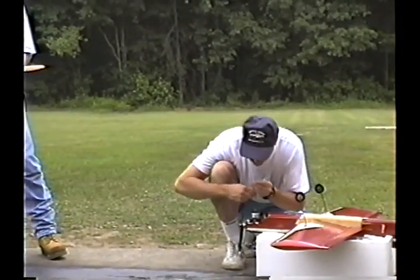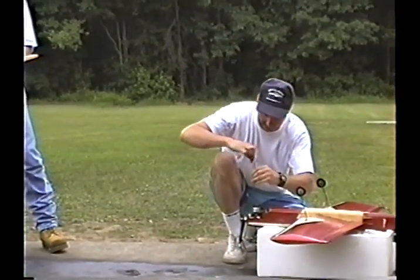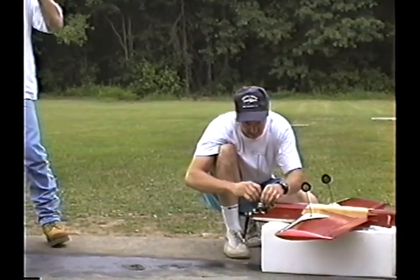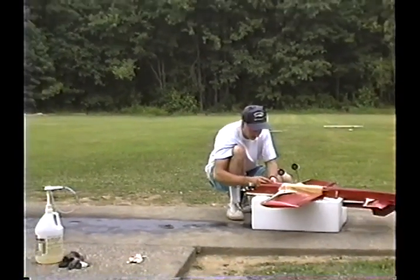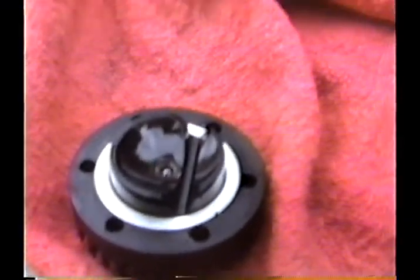The rules should all be pretty much the same. Correct. It should wind up with a 312, 315 Venturi and enough compression to give it a nice 2-cycle break, and that's it. Going the other way. And it's a Hemi head already? Did it come with a Hemi head, or did Tom make it a Hemi head? Okay. Yeah, that's a copy of a Big Jim Hemi. That's all that is.